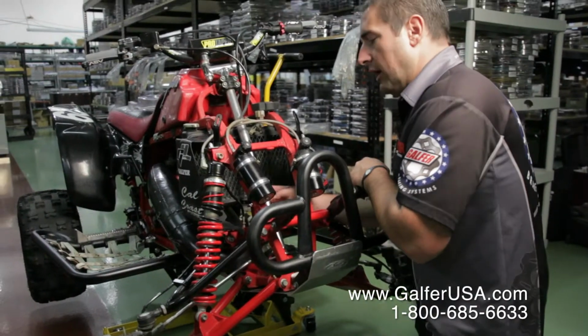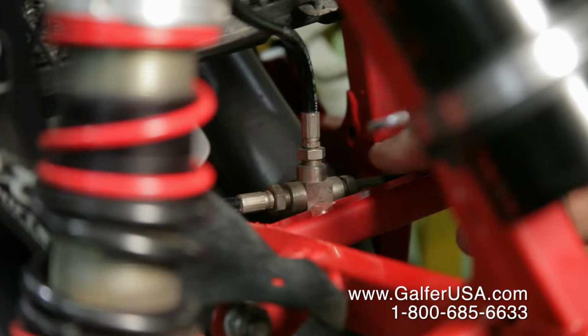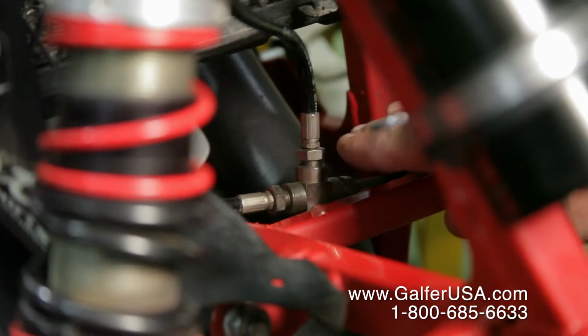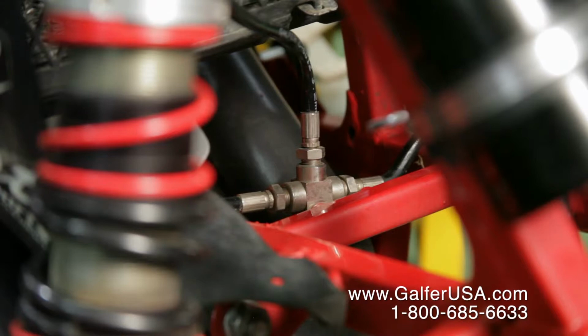We've installed a 3-line kit. We have the T-block, the top line, the lower line, and the other lower line, right and left line. None of these 3 pieces should be tightened at this point. All we're doing is installing it, so the piece itself should be able to move without any problem.